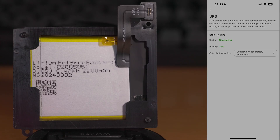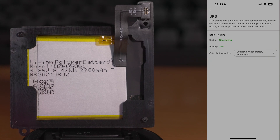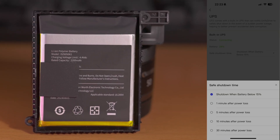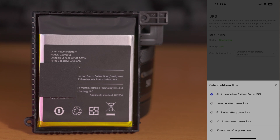The next thing is the internal battery. This unit is running off of its own built-in, about 8 watt-hour lithium battery, which is listed as a UPS inside their software. With the battery life it provides, I kind of think of it more as a UPS than a traditional battery. Battery life I tested in a near-idle, light file-copy workload was about 50 minutes, which worked out right when I do the math of power consumption versus watt-hours.